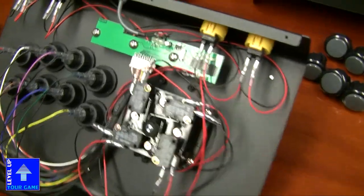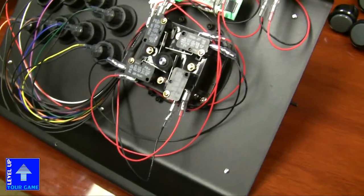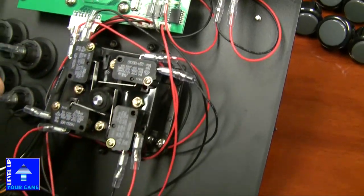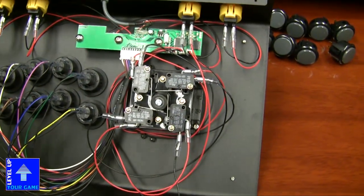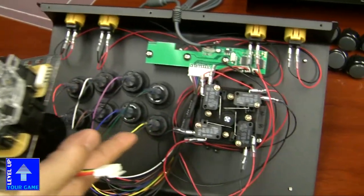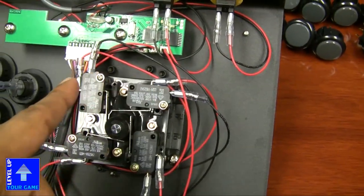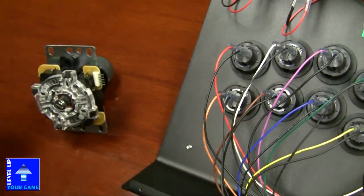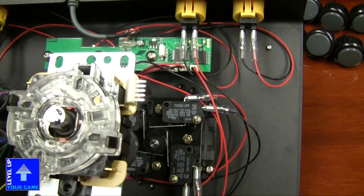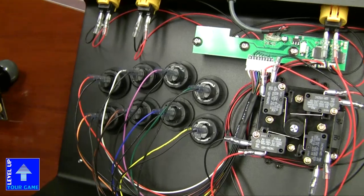Most sticks cannot support Sanwa sticks being swapped in for Korean sticks, and this stick can, and why is that? Well, as you can see, the mounting area is a universal mounting area where you can easily swap a Japanese stick and a Korean stick. Yeah, and so basically these extra holes here are the mounting holes for the Japanese stick? Yeah, so you have the mounting plate right here, and then these will align, and that's how you can swap it out. Got it.